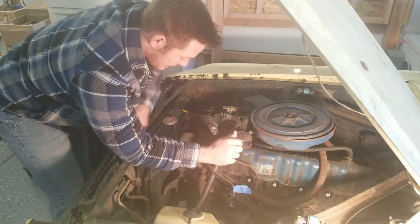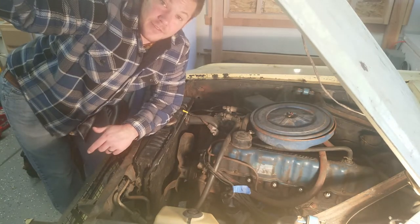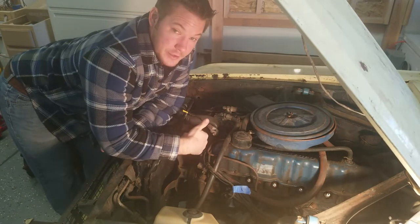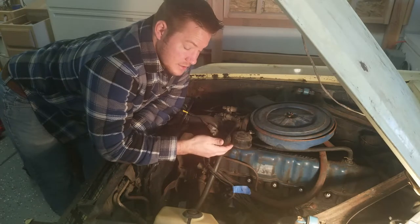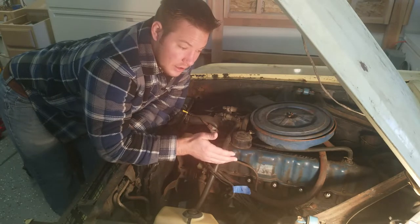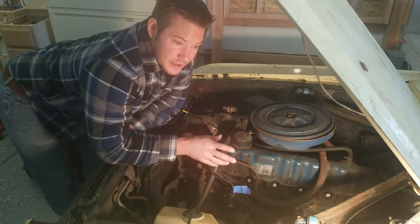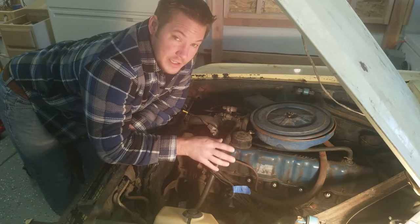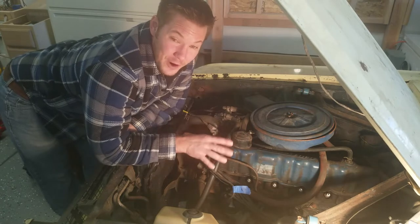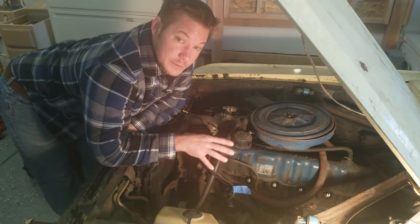If that doesn't work, I've got two to three options left. One: I could put an extension on the breaker bar and give myself an even bigger moment arm — though there are limits, because you don't want to exceed the torque capability of the main crank bolt. Another option is to roll it out into the street, toss it into gear, and let out the clutch so the momentum of the car via the transmission and main crank breaks the cylinders free. I don't particularly like that method because it could put excessive force on the car, and I'll have to fix the brakes first since I had to pull the drums and shoes off — they were all seized.